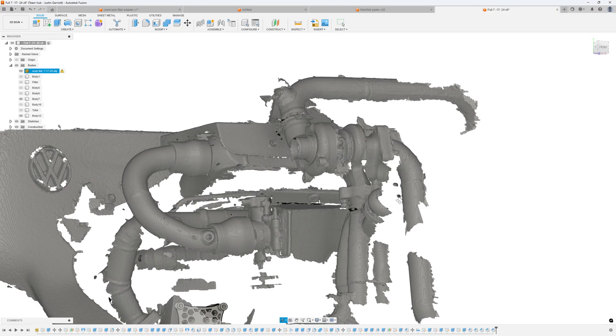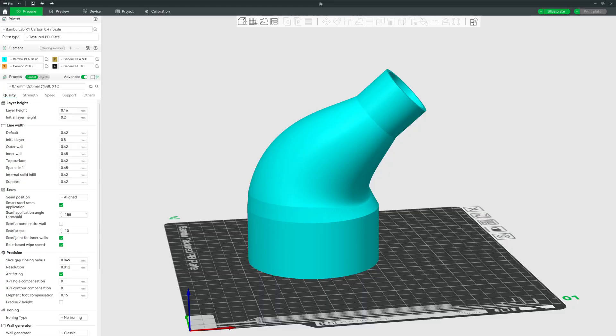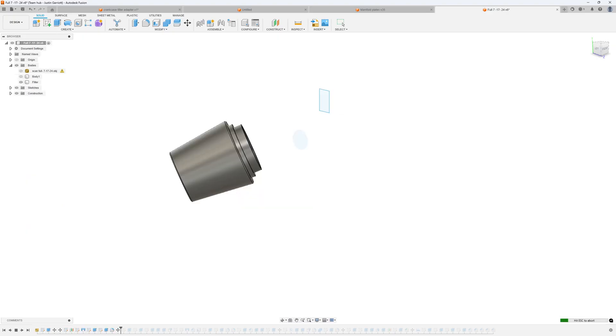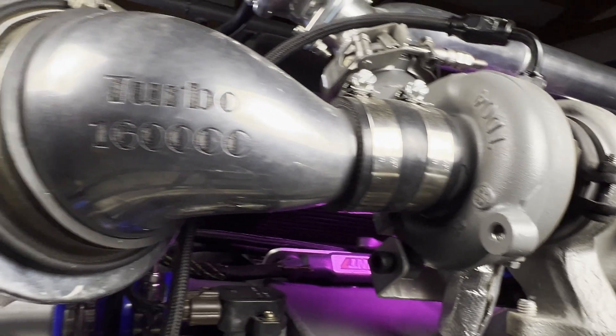To capture the area's geometry, I fired up a quick 3D scan — this is the expensive method, totally optional — but it meant zero cardboard templates and almost no prototypes. Inside CAD, I modeled the filter with the caliper method; sometimes it's just faster for simple objects. I then lofted two cylinders, shelled the wall, and embossed some fun yet informative text.